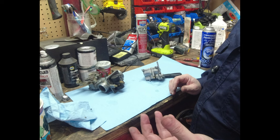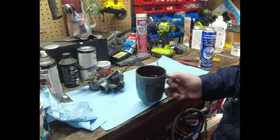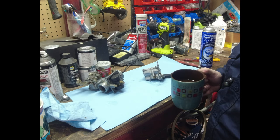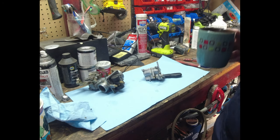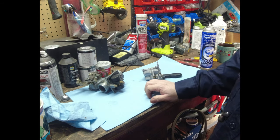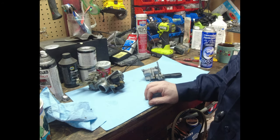I got to get some specs and stuff out of it, because the main thing I'm looking for is, when you got surging at mid throttle, it's probably a vacuum leak. A lot of other problems you're going to have with carbs, like they're either too lean or too rich, there'll probably be more constant problems, like it's not going to idle. But surging is probably too rich or too lean at the upper end, like not the top end main jet, but I'm not explaining this very well.